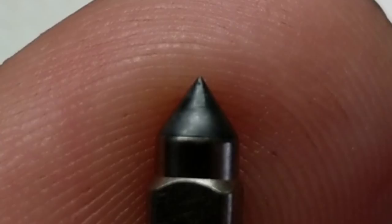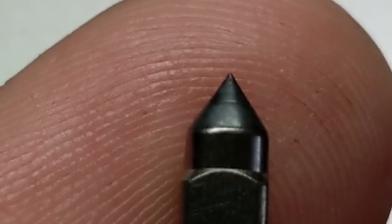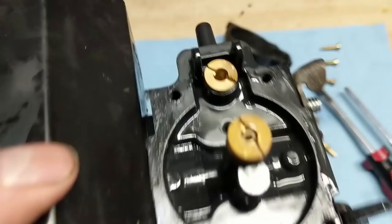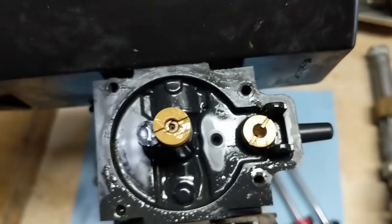You can see that slight little ring formed around the rubber tip on the needle valve. This is exactly what I explained in my previous video on leaky needle valves — over time the fuel puts constant pressure on the needle valve, always forcing it into the seat, which is right here on the carburetor. On this model the seat is removable and replaceable. I'm going to use a slotted screwdriver to remove the seat and also the main jet and distribution tube.